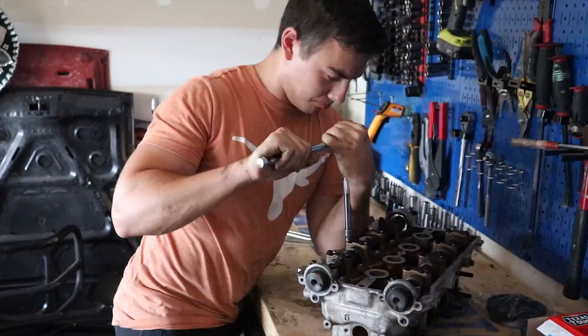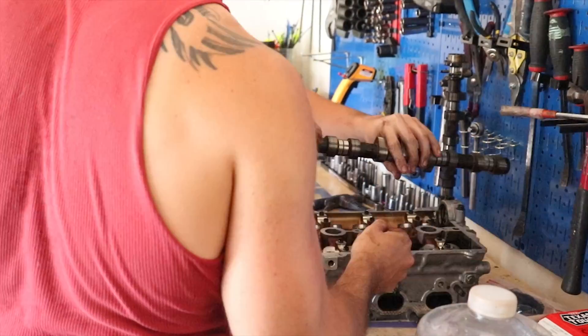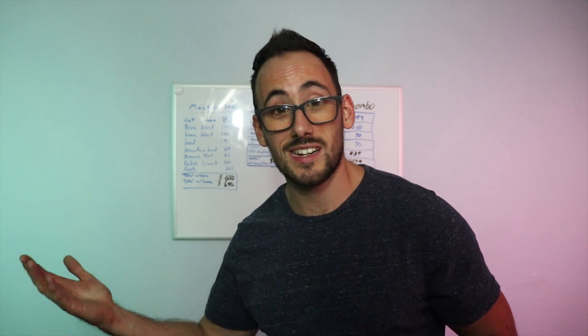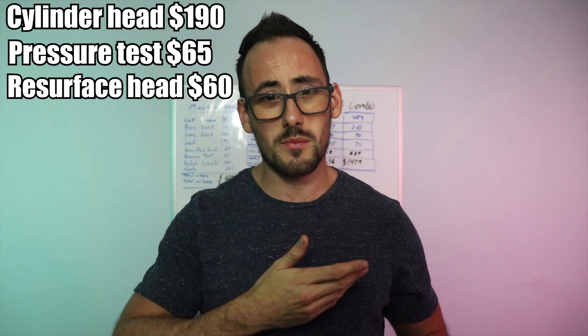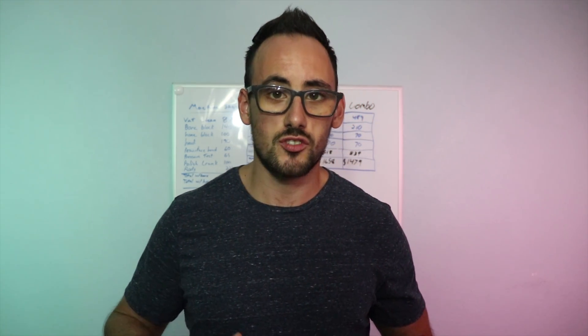The other big variable is the cylinder head. We brought them a bare cylinder head with just the valves, springs, and retainers. They're going to pressure test it - they fill it with water and check it with plexiglass, CC it, check the seal to identify any bad valves. The cylinder head work is about $190 total: about $65 for the pressure test and $60 to resurface the bottom of the head - shave about a thousandth off to make it perfectly straight. Austin more than likely warped his head.